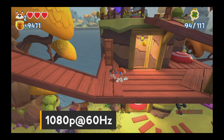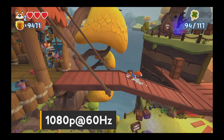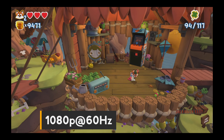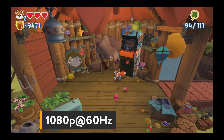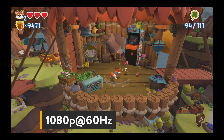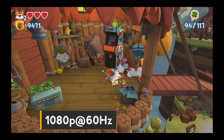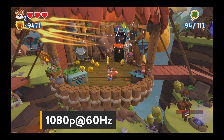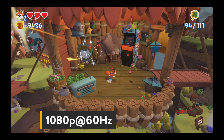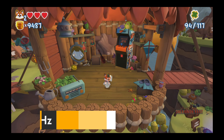It's exactly the same footage, and I did this on purpose — I just wanted to show you that this is actually not the fault of the UHD Pro. The Xbox One X, the Series S/X, the PS5, the PS4, and many other contemporary video game consoles simply don't support 4K at 30 frames per second output. So if you feed it 4K at 60 frames in, you get 1080p at 60 out. I just wanted you to be aware of this in case you were planning on buying this box specifically to try to get 4K at 60 recording.